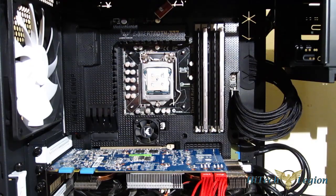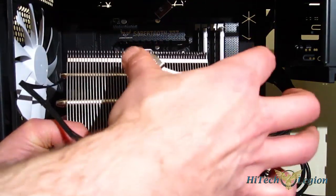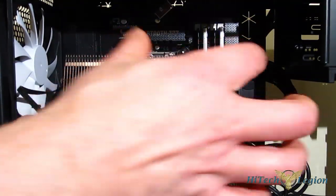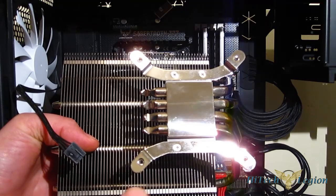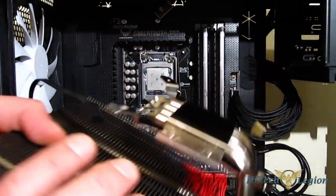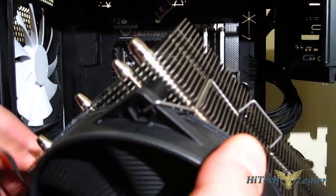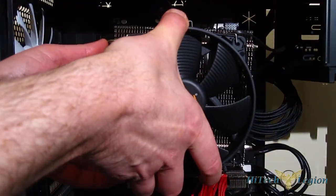With the mounting system in place, next we mount the cooler itself. I have affixed the mounts onto the contact block — four screws — with different retention brackets for AMD, and two different ones for Intel: 1155/1156 having their own, and 775/1366 sharing a common bracket. The placement of the cooler is very important: you never want the pipes facing down. Ideally, if you can fit it in your case, you want them facing up, and worst case you can do a side-to-side mount.